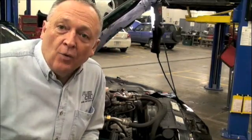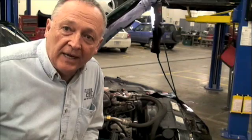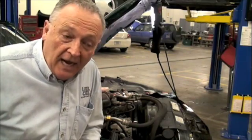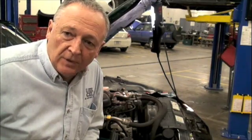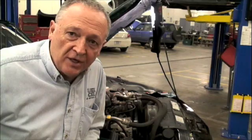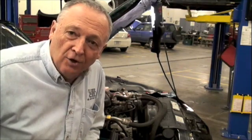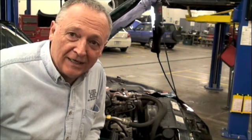Okay, it's done. We've got it running — it's running actually amazingly smooth. Now we're still on regular gasoline because we haven't put any E85 ethanol in it yet. That's my next stop. We're going to run this for about another ten minutes and then go find an E85 station. We're advised to put in about half and half for the first tank, so four or five gallons of regular fuel and a complementary amount of E85 ethanol. After that, I'm told we can go ahead and put in straight E85 from that point on. It's taken me a little over almost three hours between learning how to do things and putting it all back together. All in all, it's been a fun experience. We'll continue to report and see how it goes.